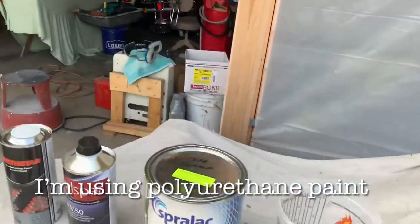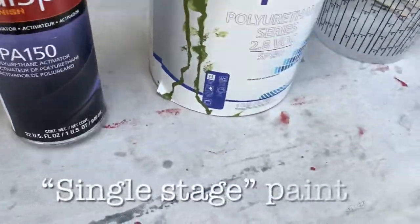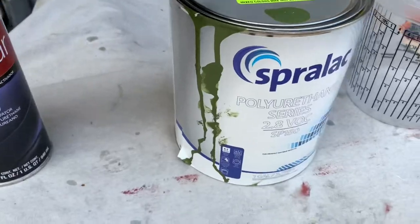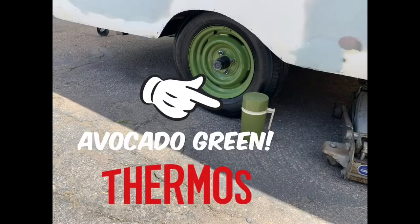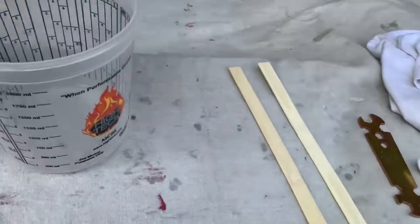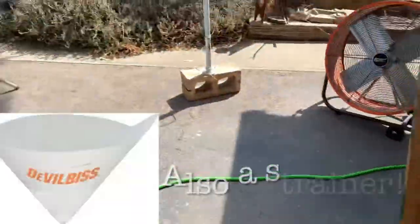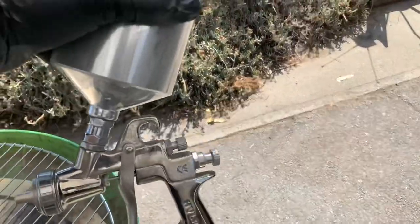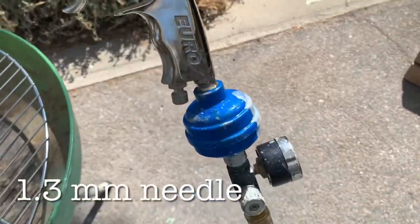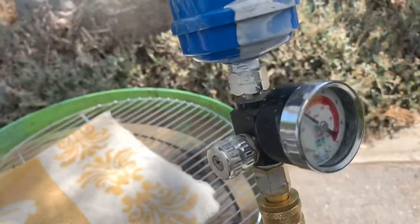Okay, so here's what we're doing. I just went down and got some reducer, activator. Here's the color we're using right here — it's our avocado green. It looks kind of dark in the shade. Mixing tub, some sticks. The gun is all cleaned out, ready to go. I have my pressure all set. I put an extra little inline filter in there, and then I can adjust the air.